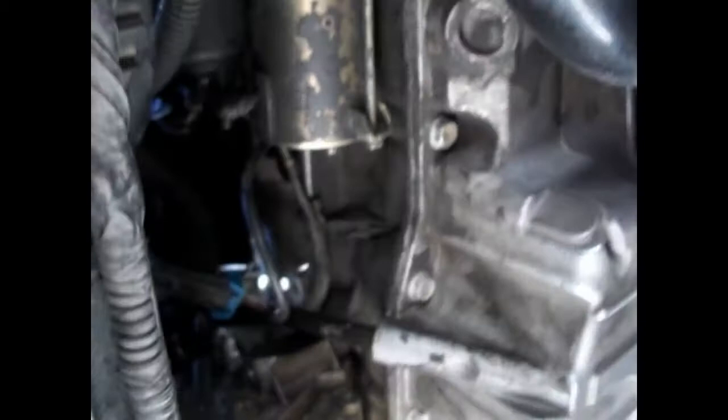Here's a tip for those who haven't worked on these cars. I've been working on J-bodies for almost 13 years. Go behind the front lip — there's a piece of metal right here that is part of the subframe. It holds your engine in place as well as all your front suspension, steering, and everything else. It's very strong, made out of steel. I use this to jack the car up from the front. Use the center for your jack, put a jack stand on each side — it holds it up nicely and stably. Just make sure you use the steel beam and don't hit anything else.